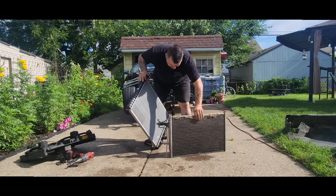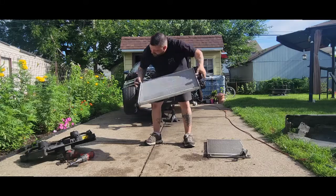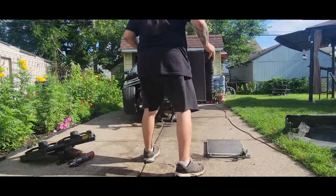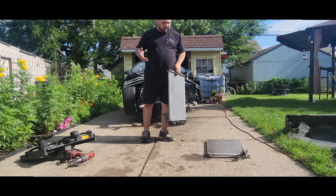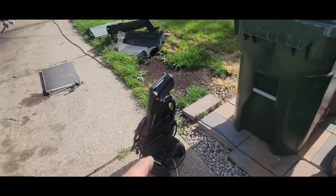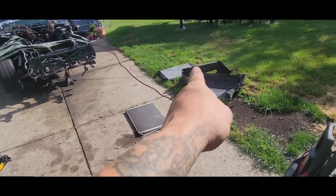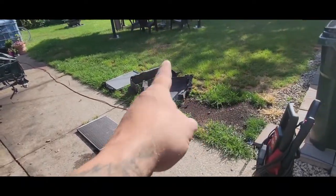What I don't understand is it looks new, but there's a sludge in here. We're going to see if we can get that out from inside — there's something inside there. They probably used some kind of stop leak or something in the car at one point and it's made its way into this radiator. So we got the pressure washer out, let's get the hose hooked up. I'm going to show you the chemicals we're going to use. We're going to clean the condensing coil first and the radiator, then we'll get the fans, the housing, and all that.